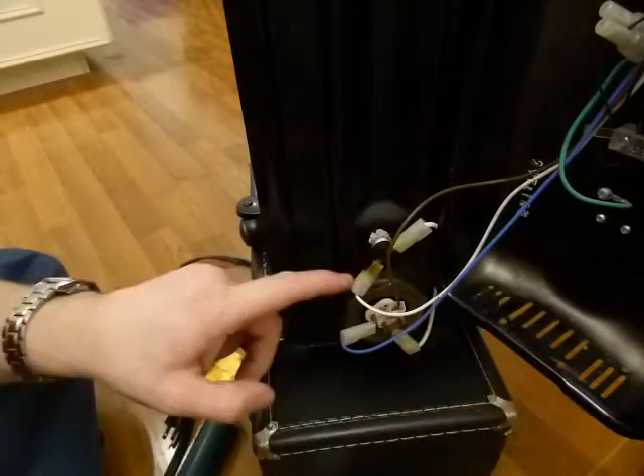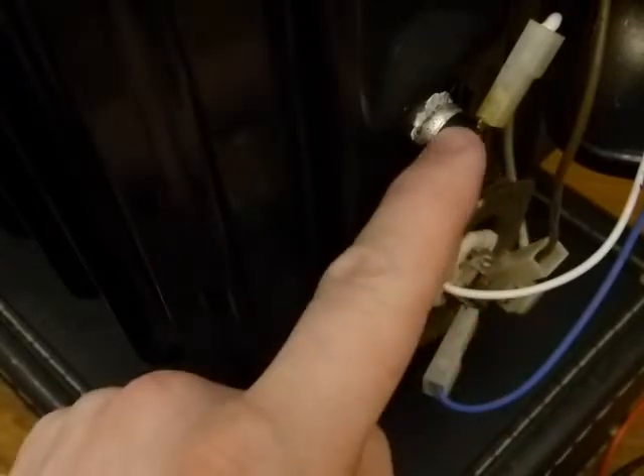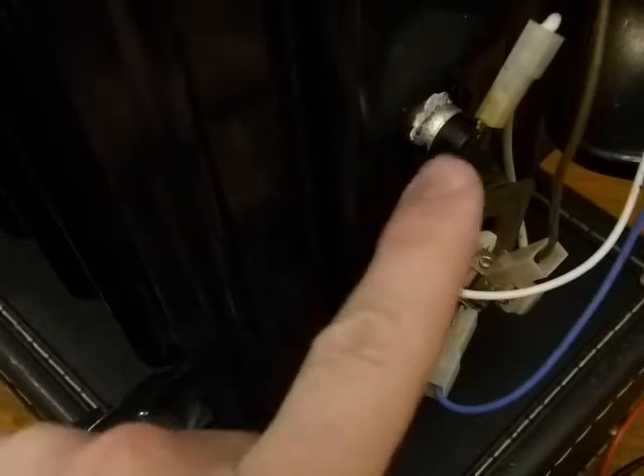There's a bit of charred wire here, and a charred socket. This component isn't exactly a thermostat — it's more like an auto-resetting temperature switch. It's got a flat plate of steel that, when the oil in the radiator heats up, bulges outward and breaks the circuit. When it cools down it snaps back and closes the circuit. That's the kind of auto-resetting switch this is.